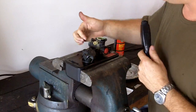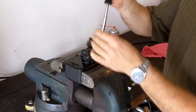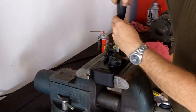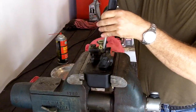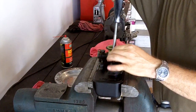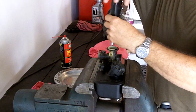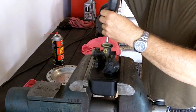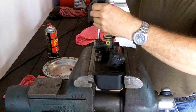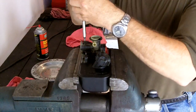There are five screws. We're going to take those five screws out. I've got a little pan — I'll just put them in there. All the screws are exactly the same, so you don't have to worry about which one goes where. Briggs & Stratton kept all the screws the same size. There's not one longer than the other, so it's pretty easy.